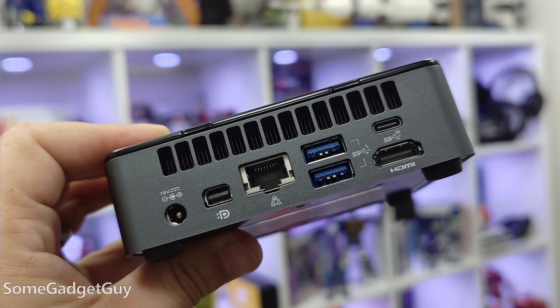I did the initial setup over the built-in Wi-Fi, but that's not going to be good enough for a dedicated Plex server. We want to use the gigabit ethernet on the back — that's plenty fine even for 4K Blu-ray. Get the data to this box and then it sends out the transcoded information over a mobile connection. This is all going to get cabled up and re-plugged next to my router on a little bookshelf in our main hallway. If something happens or I need to run updates, it's a pain to pull it out of its enclosure and move it to an office with a monitor, keyboard, and mouse.